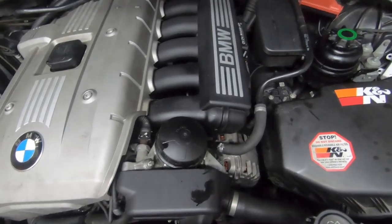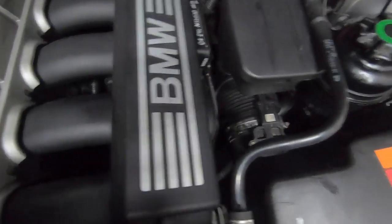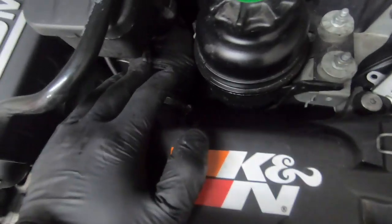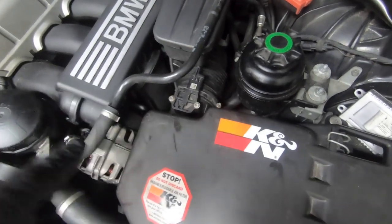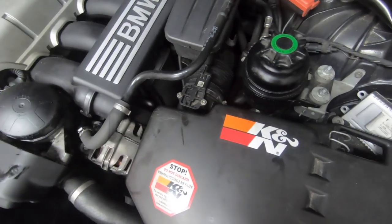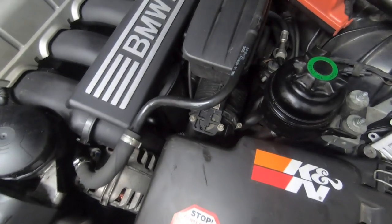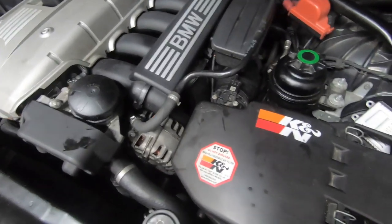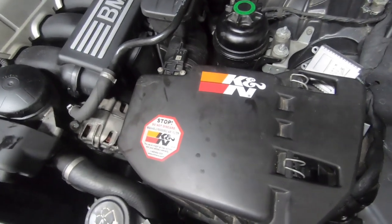It's not a hard job at all — it just takes common sense. All you've got to do is remove the air filter box, remove your intake duct to the throttle body, and optionally take out the 10mm bolts on the throttle body to give better access to the junction box. Disconnect it and you'll be able to see it immediately once you remove the throttle body. You don't need to remove the whole manifold.